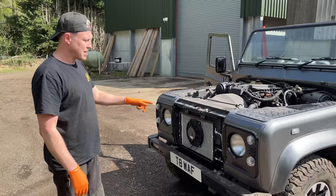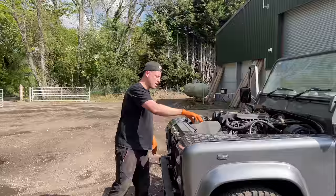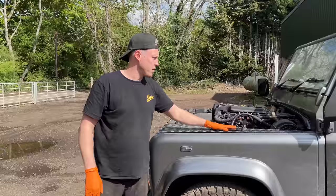Now we're still to gas up the system, but we fitted the coolant pipes. It's one of those installations that's a little bit difficult to film. You've got to fit a dryer, fit a condenser, fit the compressor, fit a new belt, run all the pipework forward, and then do all the wiring and the heater matrix in the front there. Now the AC has been installed, and we're yet to gas it up.